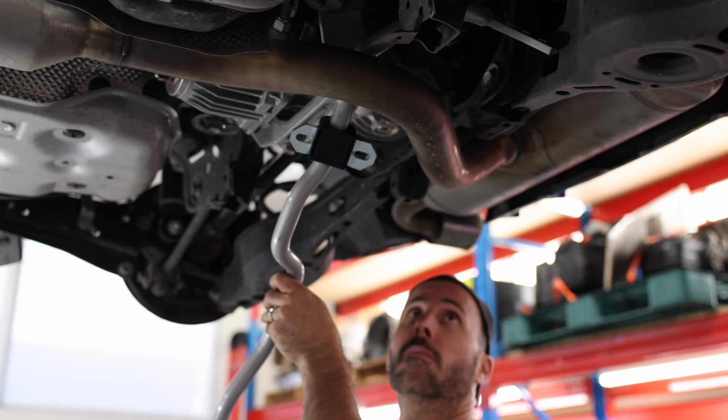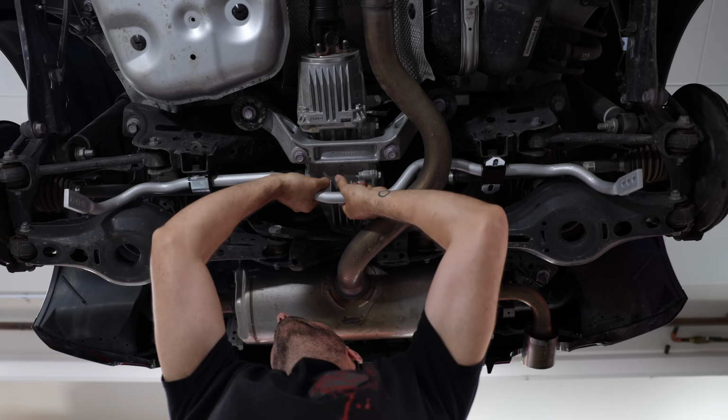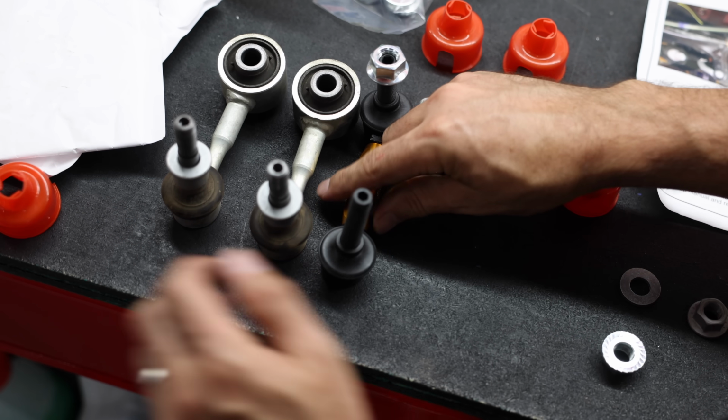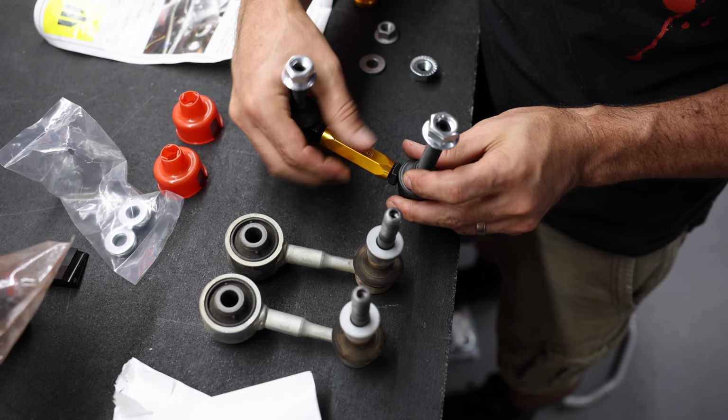The rear sway bar sits in the same position as the original one, but comes with new bushings and saddles to hold it in place. Visually, the main difference is the three holes at either end, which changes the behaviour of the bar depending how you mount it. In essence, it's three sway bars in one, and something that's simple to adjust at the track if you want to fine-tune it.